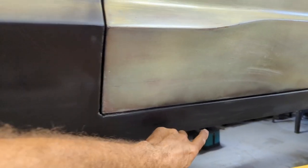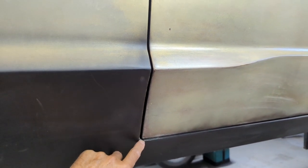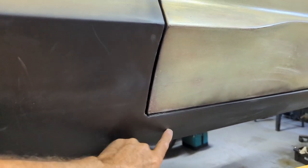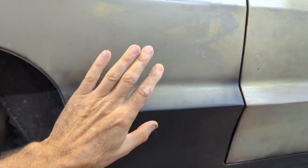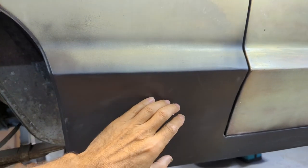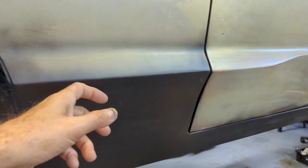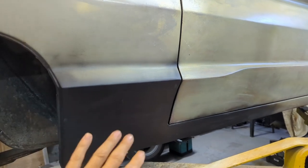When I got this car, there was a dent here in the rocker and it actually broke the filler that was in here. This filler still needs a little sanding but I can't get the door open very far when it's on the lift. I took out all the old filler that was in here. If you're familiar with these cars, that's a leaded joint originally, but this quarter panel has been replaced — it was an OEM quarter panel, done early in the car's life because there's only two paint colors on it, not three. I refilled that and leveled it all out. It'll have to be color matched, but we're thinking about painting this car, so I'm just leaving that part in primer for now.